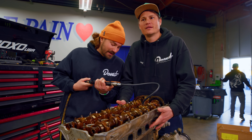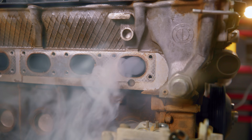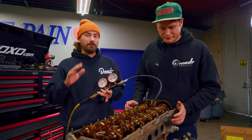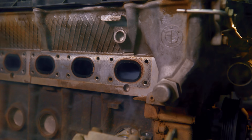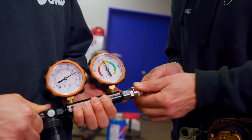It is pretty bad — you can hear a leak. We're at top dead center on the combustion stroke in cylinder one so all the valves are closed. It's meant to be a sealed cylinder, but in our case it's not. We've got about 75% leak, which is pretty bad. We can also run some smoke in there to get a visual, because it's one thing to know you have a leak but another to know where it's coming from. In our case it's pretty obvious it's coming from the intake port or the intake valves.